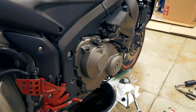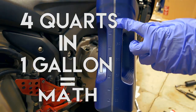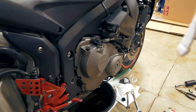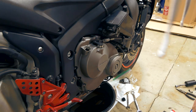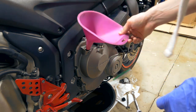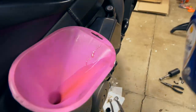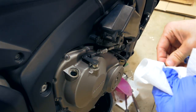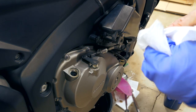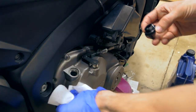Now we can start pouring the oil back into the bike. Since we got one gallon of Rotella T6, there are four quarts in a gallon. If you buy it in quart bottles just pour about three in there — it says to do 3.1 quarts but you'll be safe with three. Once you pour three in, grab yourself a clean funnel, set it up at the port, and pour it in. Once all the oil is in, level it off and see where you're at — you might need to add a little more. Wipe the area clean and screw your cap back on.